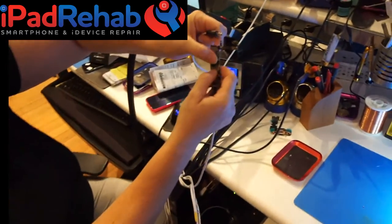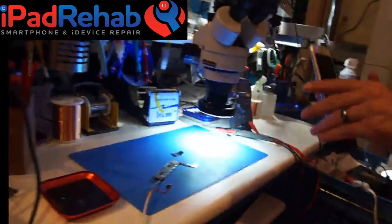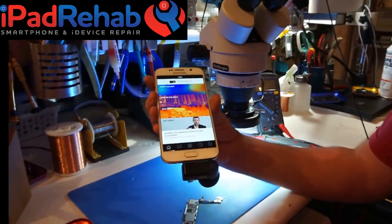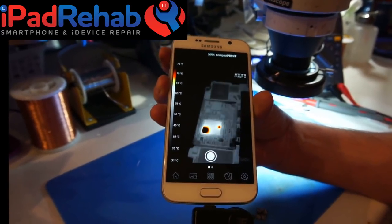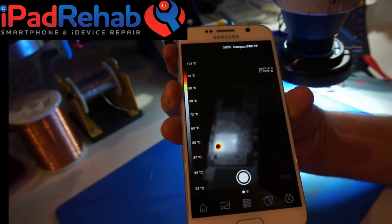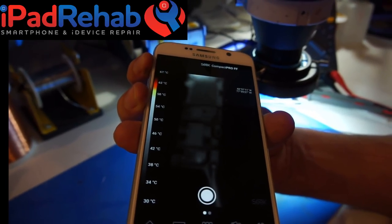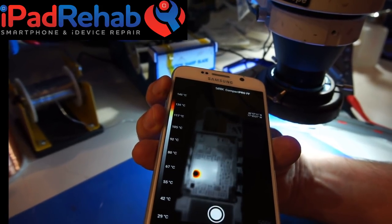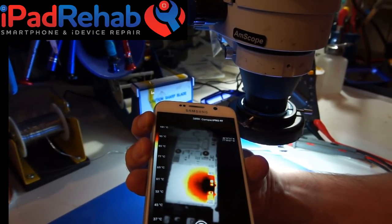Let's see if the camera is as good as my face. I'm ready — here is current. Camera says PMIC, which is down here and not audio IC. So that means look really hard to see if you have any kind of physical crack in the PMIC. If you do have a physical crack in the PMIC, that's the only way that can get damaged. What's going on up here is none of that — no problem there.